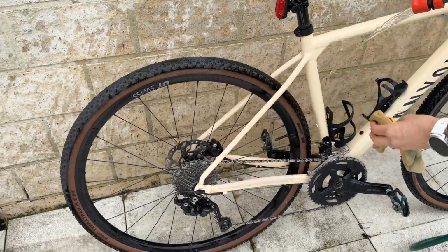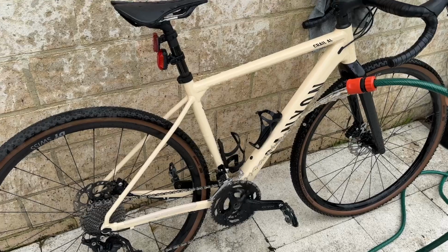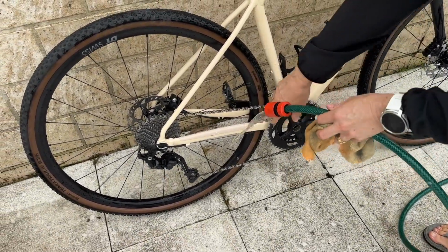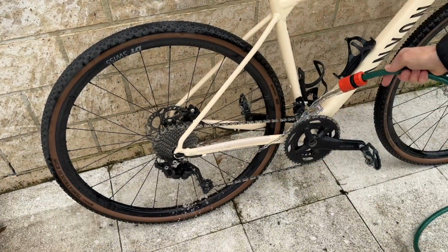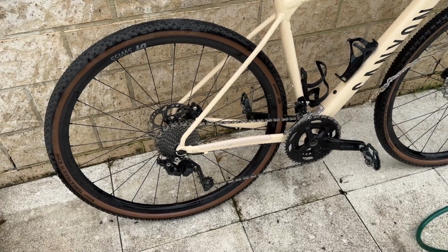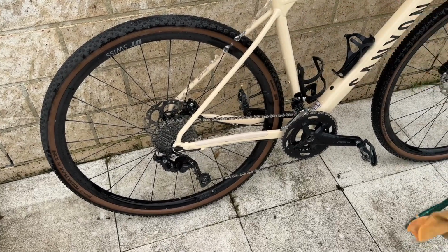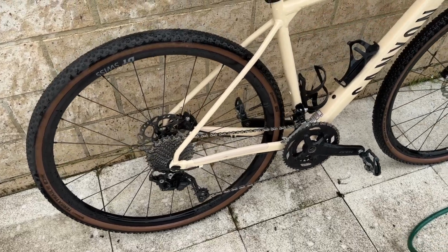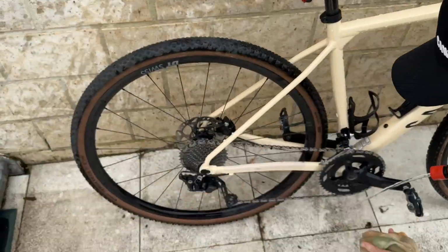What about a pressure cleaner? Can you use a pressure cleaner to clean your gears and chains and cranks and stuff? I would not recommend it. You're just blowing off grease that is important in your crank. You're blowing off grease in your axle, any necessary grease that the bike has to have in order to function well and not bring damage to the bike. So just a gentle water flow like that's all you need. I'd concur with that. A pressure cleaner is going to wash grease out, and it's going to push dirt and garbage into the wrong sort of places.